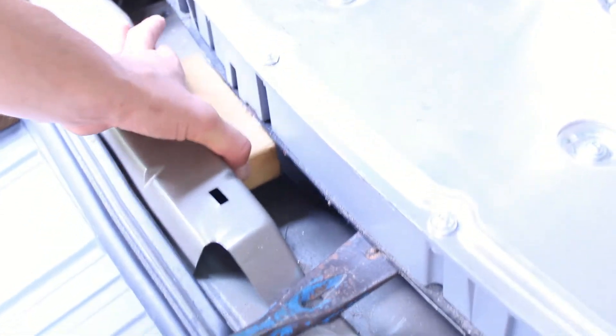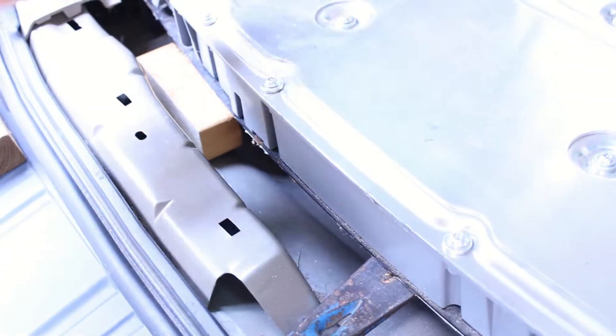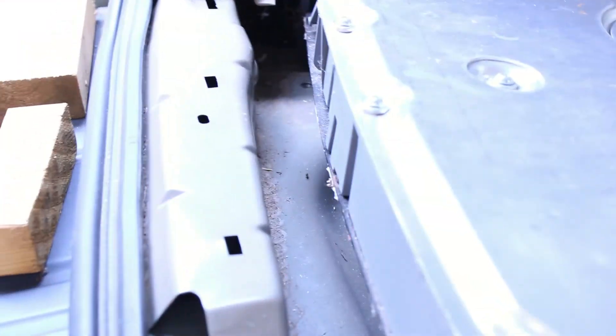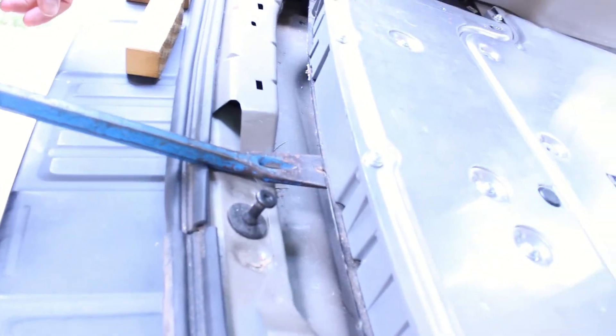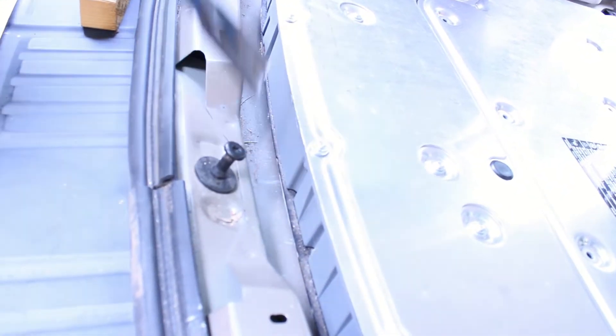Here's the back end of what we were doing with all the levering — that little piece of 2x6 is how we started propping things up, one block at a time, using a 2x4 to lever it higher until we could get our strap system in to lift the battery up. Now we're lowering it down. Be careful anytime you're lifting like this — don't get your hands in a harmful position. If someone's working with you, make sure they're clear of any crush points while you're lifting. Now we lower it into place and make sure the bolt patterns line up.